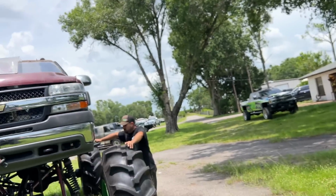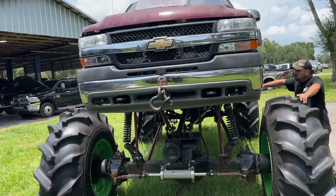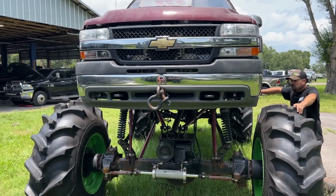So we're going to get our blown big block here pulled out of old Ron Burgundy. We'll see what happened. We already know kind of what happened to it. It's obviously, we've got some bearings that are spun out of the rod bearings. So we're going to get it out. We'll pull it down, take a look at them ourselves, see what they look like. And then at that point, we'll be able to do some measurements, see what size piston we're going to have to get for it, whatever overhaul kit it ends up being.